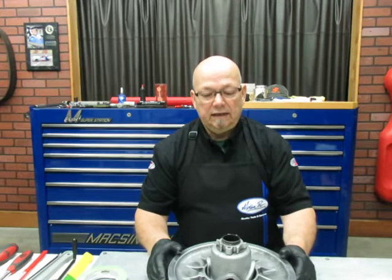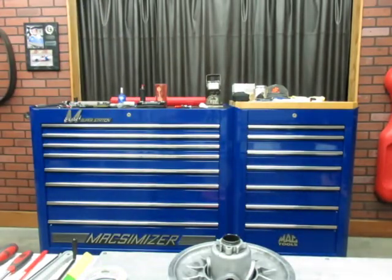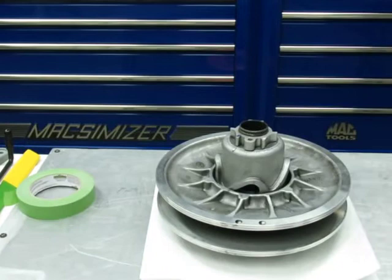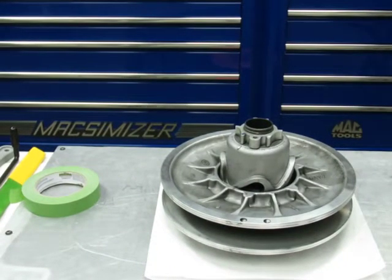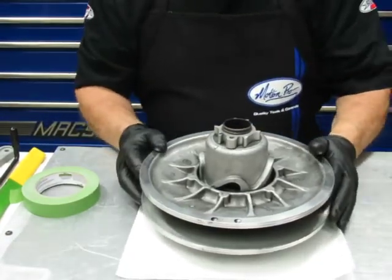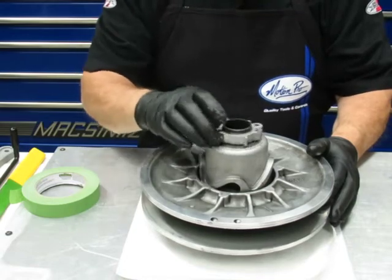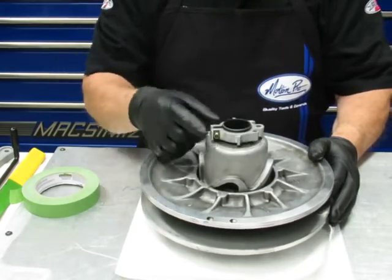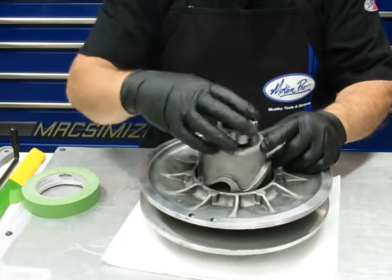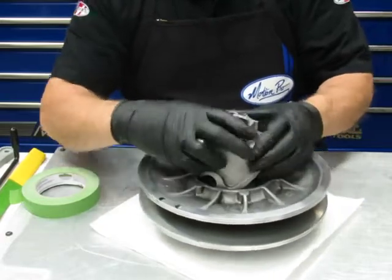I'm going to adjust the camera and we're going to get right into the tear down. Okay, we've got the clutch off the sled. We're going to spin this off — we've got this loosened right up. It's going to be right-hand turned because it's left-hand threads to get it off. We've got the screw loosened up most of the way. No need for the compressor at this point because the bolts are still in the back holding the helix in, and we'll get to that in just a minute.